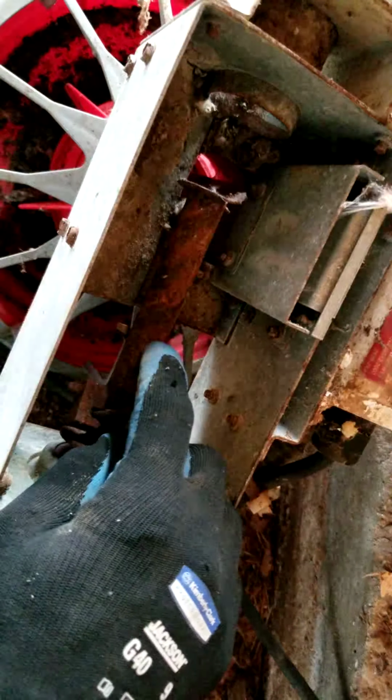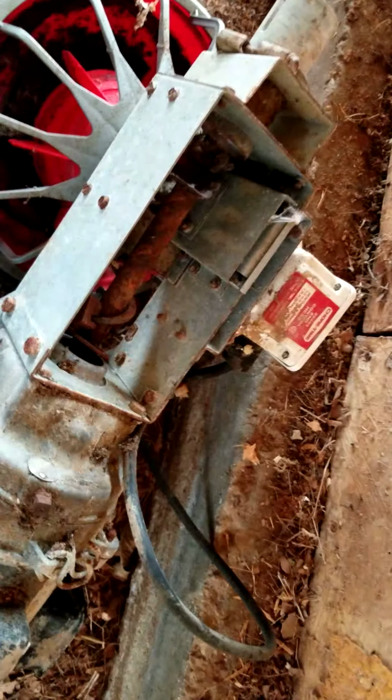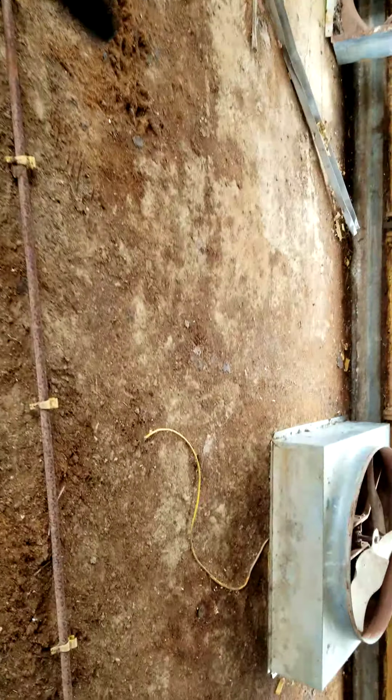And with that, just be really careful, don't have your hands inside of here, because once you cut this, that spring, that flex auger, does have tension on it, and so potentially it'll go real quick, and it could really mess up your fingers. So just be sure that you're clear of that. Once you have the auger detached from the motor, then it'll just be hanging here on the end. This last section is already out, but it'll just be hanging here on the end, and so just unhook it and remove the motor, set it aside.